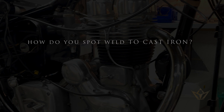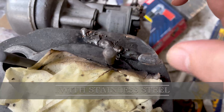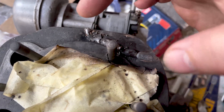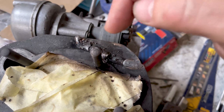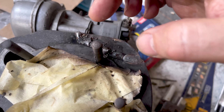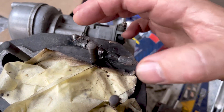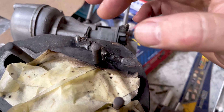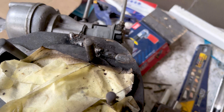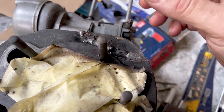That's the result of spot welding. You spot weld in the center, then one out, second out, and so on, so that the cast iron — which doesn't expand as much or as quickly as the mild steel — gets heated up preferentially. When you weld, the mild steel will expand, so you've got to let it cool before welding again while heating the cast iron. The trick is to keep them together so that when the motorcycle gets hot, the cast iron heats first from the piston side, and the mild steel reacts last, expanding in a more controlled manner from the weld points. So it shouldn't ping off — but we'll see.